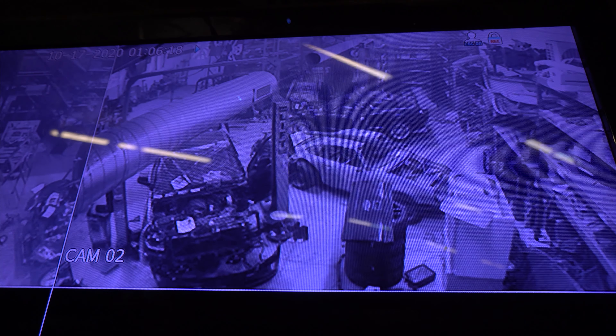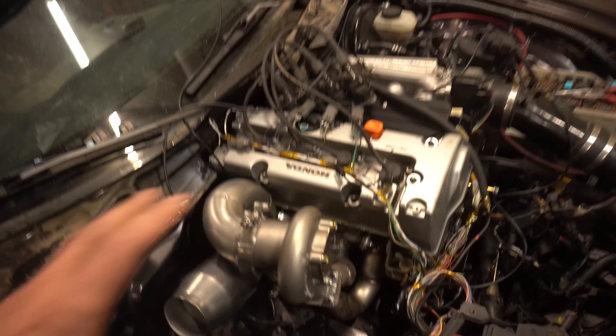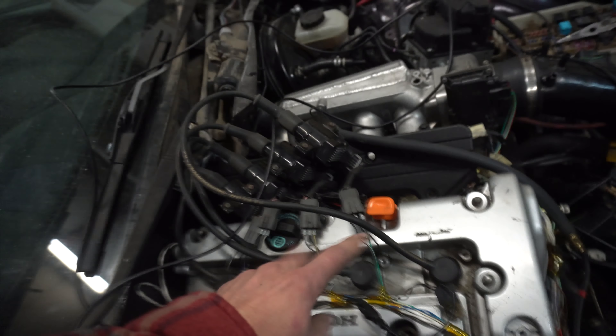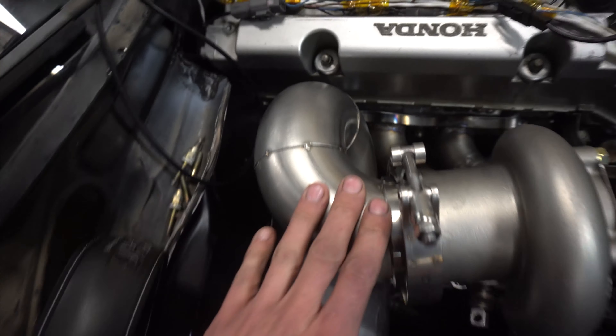We had a little fire going — it's okay. The fuel VE map was way too high and a giant fireball came out of the exhaust. The only way to put out a fire in your exhaust is by cranking the motor over, so I did that and it sent a giant flame out. After much delay, I discovered the original K-series coil packs were fried, so I threw on LS coils from my RX8, put the pins in, and it starts up.